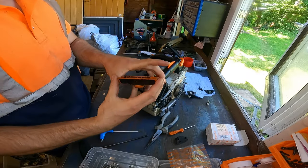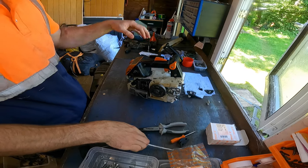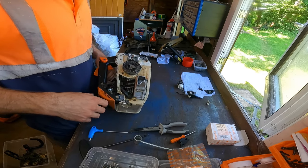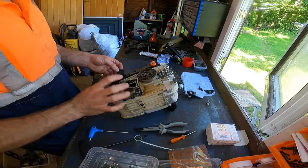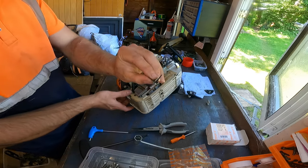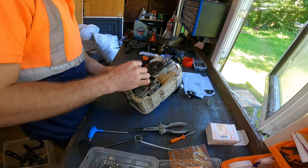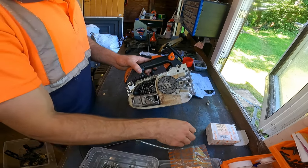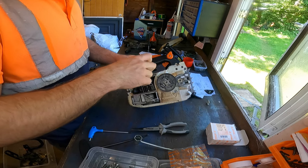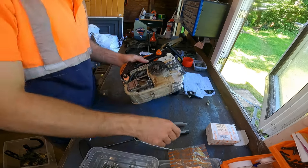So, goes on. Where is it? Push down and twist. That's on. Now what we can do is put our fresh one of these on, like so. It's summer currently, so this goes, shows you've got a sun and the icicle goes like that, so that'll block heat from the case to the carb, because it's summer. And vice versa in winter, when you change that, it lets heat to the carb to keep it warm when it's winter. That's on.